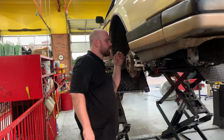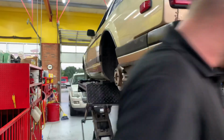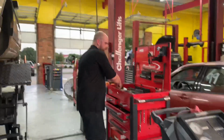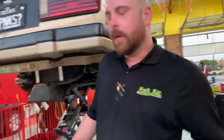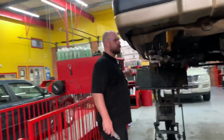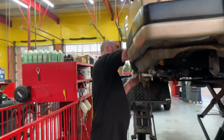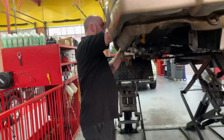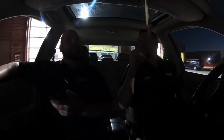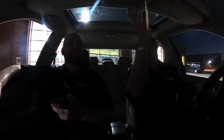So we're finally going to have proper fitting calipers, brake pads, nice refinished rotor, and honestly the rear alignment was pretty jacked too. So hopefully we'll have a little bit better toe situation than we used to, because we were about a full degree of total toe, which is pretty substantial. And here's hoping things are a lot better. Yeah, baby. Street car life.